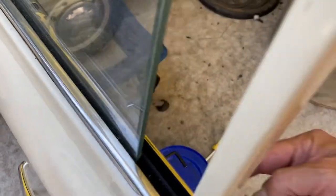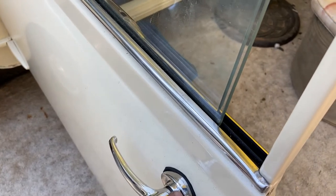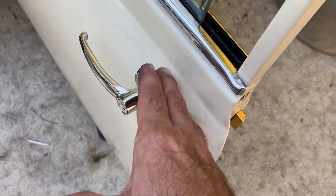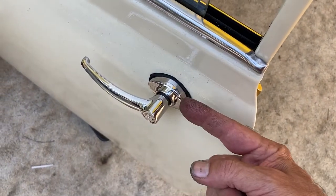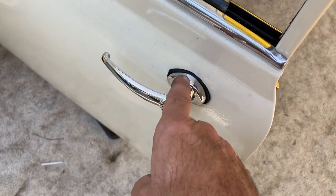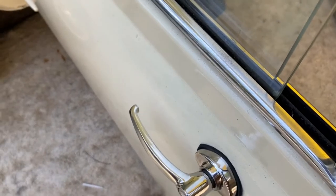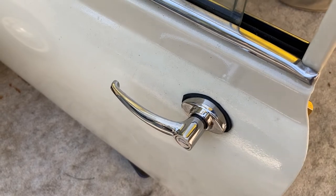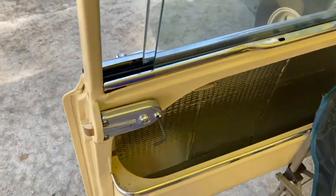We could still slip this all the way out of the square shaft by disengaging the lug that locks it in place using the key. The way these doors work, there's no magic in the latch to lock it. The key releases a little lug that goes into a cam arrangement inside that escutcheon, and then the door handle won't turn. So that's the physical lock. A strong girl could probably twist that right off and open the door, but no one knows that, so we won't say anything.